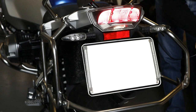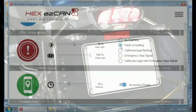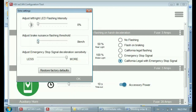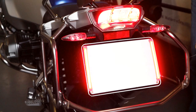You can also adjust the flash function of the auxiliary rear light. To set the brake light at constant brightness while active, click the 'No Flashing' button. To set it to flash while active, click the 'Flash on Braking' button. If the brake light flashes at a speed threshold that is too high or too low, open the Extra Settings submenu and click and drag the 'Adjust Brake Nuisance Flashing Threshold' slider to the right to increase the activation speed or to the left to decrease it. To set the brake light to California legal standards, click the 'California Legal Flashing' button — the brake light will flash 4 times per second for one second, then stay on at steady brightness until the brakes are released.